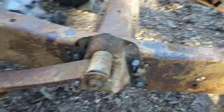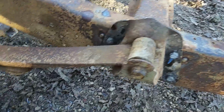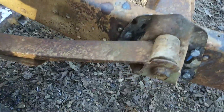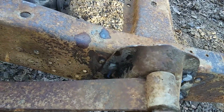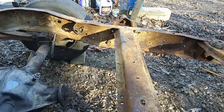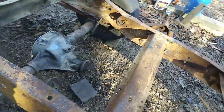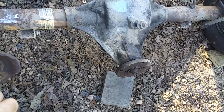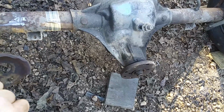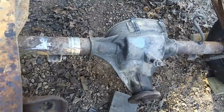All right, we got the spring mounts. We done got them reversed, and we got the bolts in them. We had to remove this bolt here and raise the spring up to get this bolt here. Couldn't drill for it, so. But anyway, we got half inch grade 5 bolts in it with lock washers with blue Loctite on. We got them tightened down, and also our angle is going to be just a little bit too much, which we ain't welded nothing on the spring perch yet. So we're going to set it up once we set the motor in. We're going to get all that squared up maybe tomorrow, Lord willing.